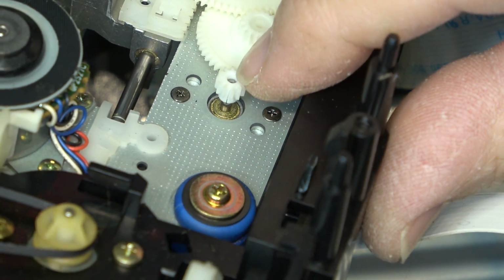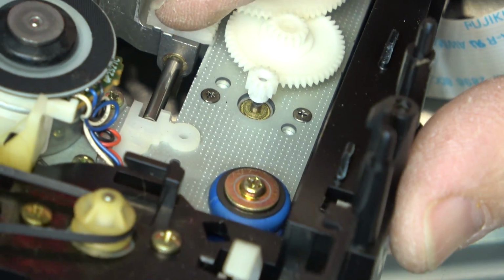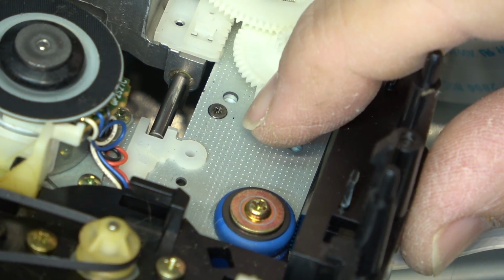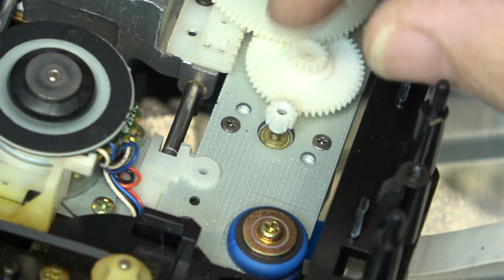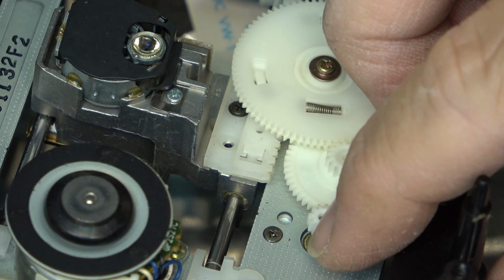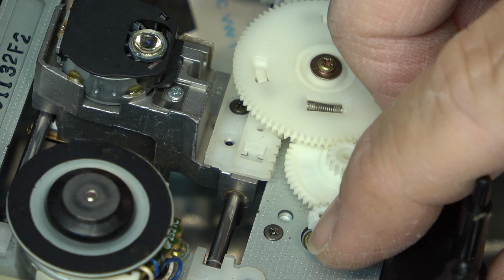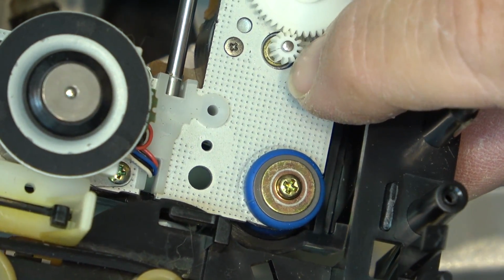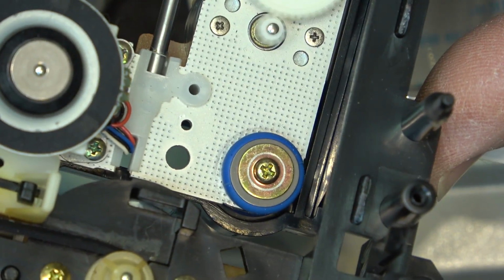And that's probably why this unit was taken out of service. You see the crack? So what happens is when it's playing, that causes it to stick. And when the motor sticks, it'll continue to play and start to build up a tracking error, and the voltage will crank up on the motor, and then eventually it'll shoot past it, and then it'll skip. And that's typically what happens on these. And you can see how loose that is.